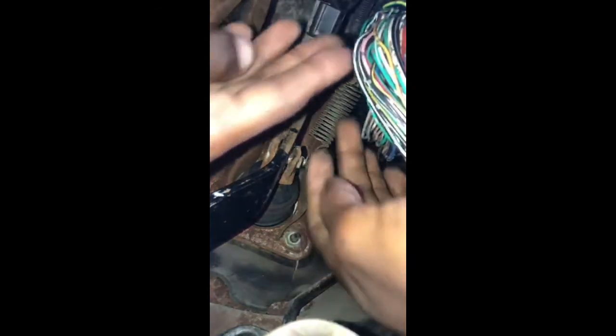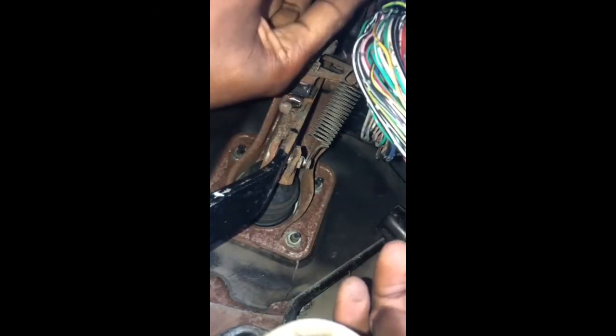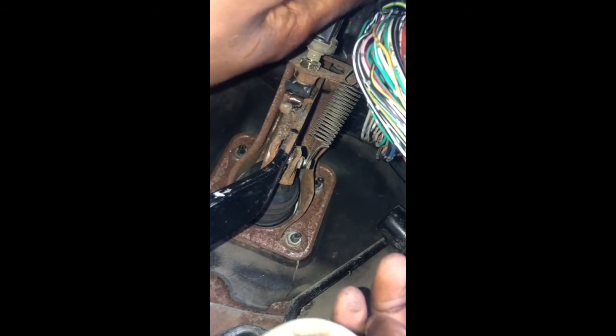I'm here trying to reconnect the main power to the brake switch to see if that was the only problem. If this was the only issue, we would find out when we go behind the car to see if the brake lights are still on. Our brake lights were off, which tells us that the brake light switch itself was good.